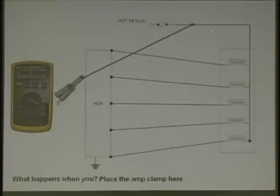So here, we would look if it's too low, and all of these are supposed to be working, okay? You're going to suspect that something is open, or we have a high resistance problem, which is what? Voltage drop. You forgot VD already. Don't forget that. You got a voltage drop somewhere. Okay, Rich. There you go.